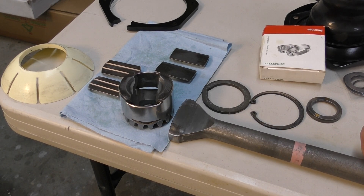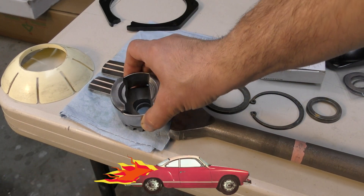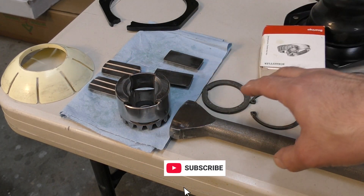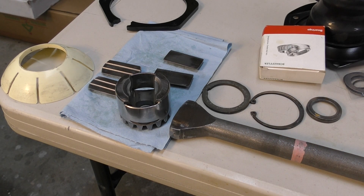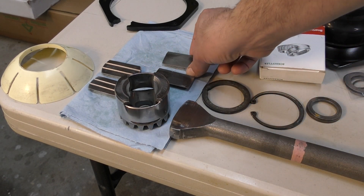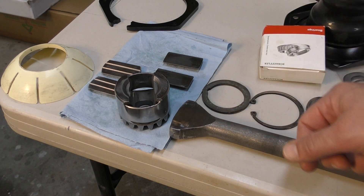This is the original left axle that came out of the car, along with the original side gear and fulcrum plates. If you're reusing your parts, I recommend keeping left and right separated. Don't swap sides and don't mix up your parts, because the parts are worn in together — swapping them could cause breakage or uneven wear.